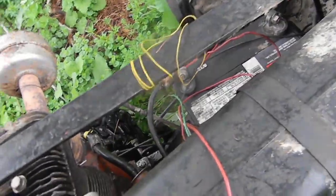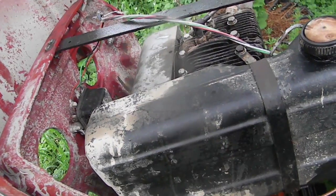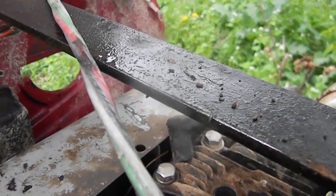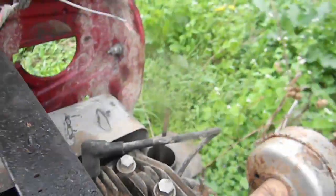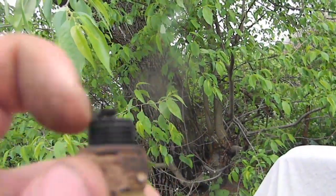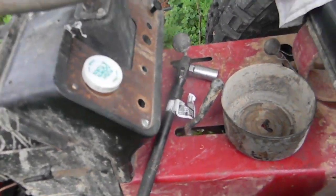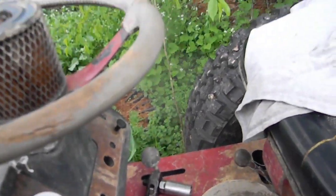That sucks. Usually that means I have to let them sit for a few hours or days. Well, I say that would do it. So with that, what the hell's going on here? I guess all the oil burning. I have crazy carbon buildup, it would seem. So burning oil all the time has its toll, it seems. I think I better start putting something like Marvel Mystery Oil in the oil and maybe Sea Foam in the gas till I get new piston rings.